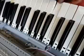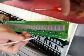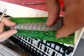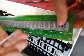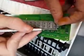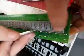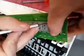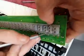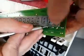And if it was a piece of dirt in the contact, the key would now be plain. Once the contacts have been cleaned, it's very easy. We make sure they're perfectly dry and we just line up these little rubber notches with the holes on the board. Put the rubber notches in, and there's another rubber notch.